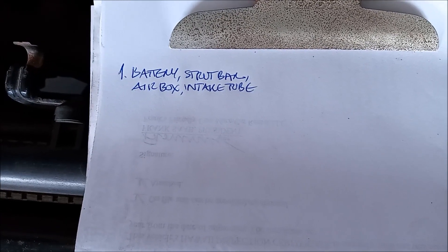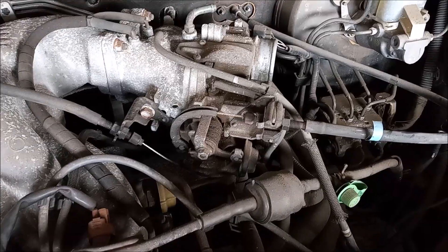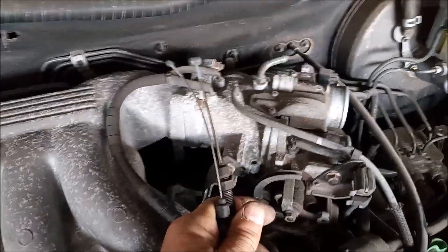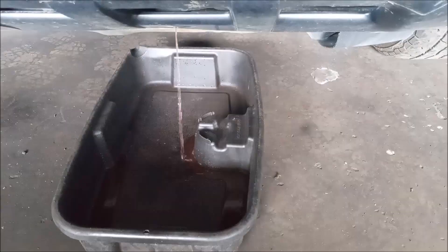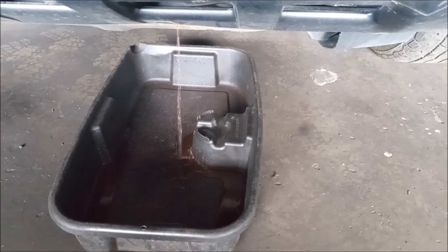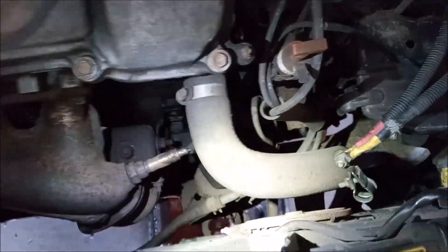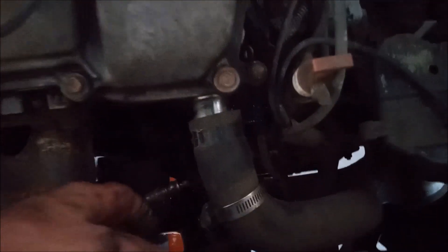This is my task list that I am going to keep as I work along. Next step is the throttle cables. Next, this engine strut mount. Drain the radiator. Remove the radiator hoses — top hose and bottom hose. Here's the top hose. The bottom hose I'm just going to tuck out of the way for now.